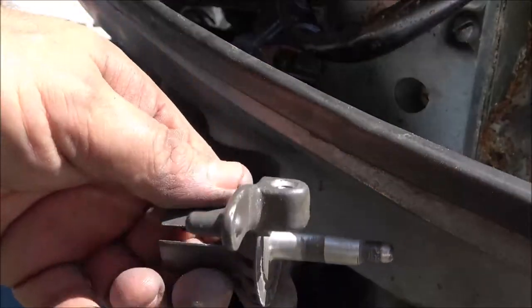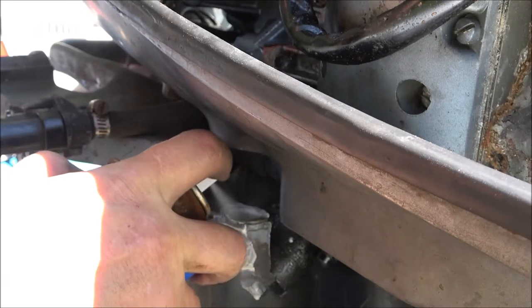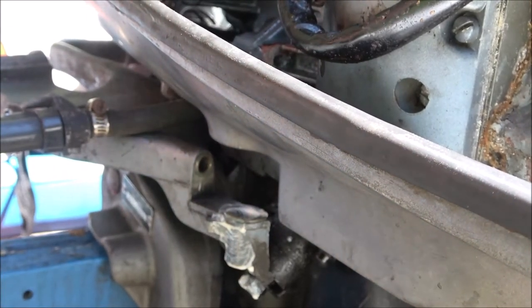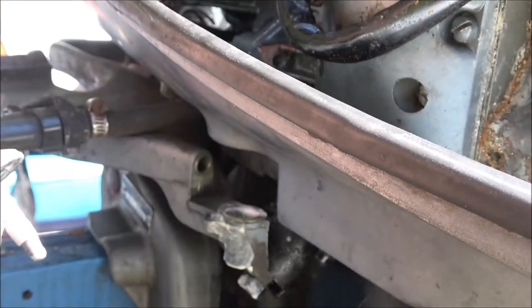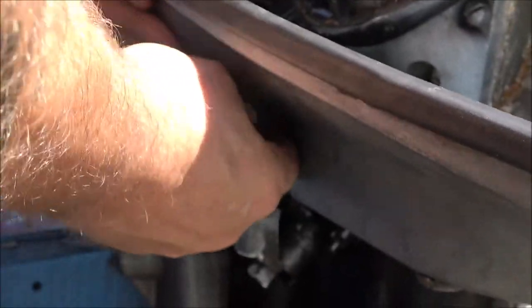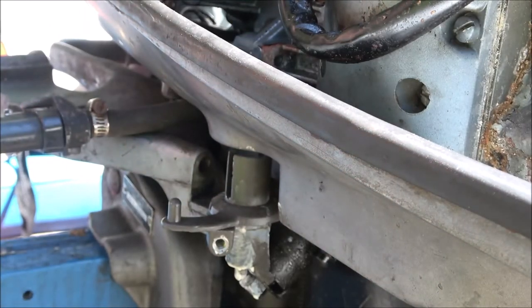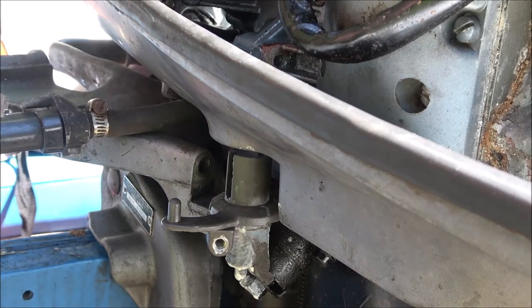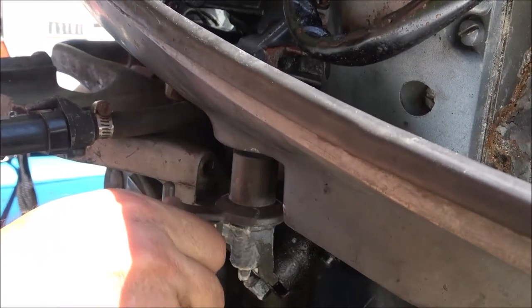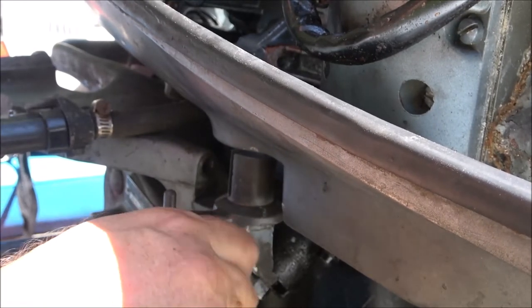I sanded this off for about five minutes. What I'm going to do is take some of this lithium grease and spray it in there — a little bit on here. Now this is where you can shoot your lubricant up through; there's another hole right there where it comes out. Let's go ahead and put this in there — yeah, look at that, nice and free. Now let's go ahead and put our idle screw in.